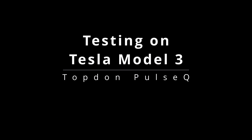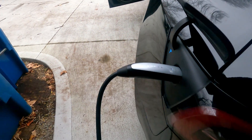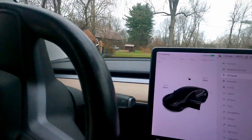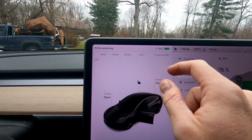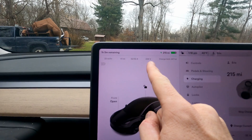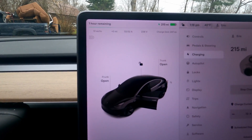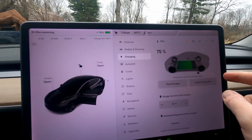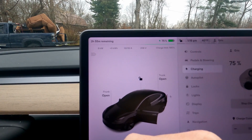The Tesla connector reaches all the way down to the back of the car — a pretty straight run. On the charging screen, the maximum is 32 amps, and at a 75% state of charge, we're getting 32 amps at 236 volts, giving us 7.7 kilowatts of power. This should be a couple of kilowatts faster if we can pull the full 40 amps from the TopDon. At that rate it was projecting just under three hours to full, so remember that number — 2 hours 55 minutes — as our baseline.